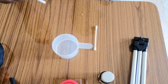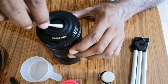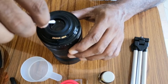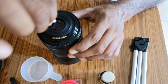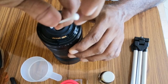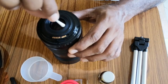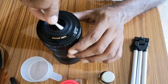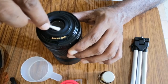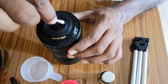I'm going to wet the cotton bud with the solvent and clean the lens thoroughly. Don't forget to thoroughly clean the edges of the lens, because that's where the fungus infection started and where moisture collects. Clean the edges and the entire surface thoroughly, then leave it for some time to take effect — the solvent will kill off the fungus.